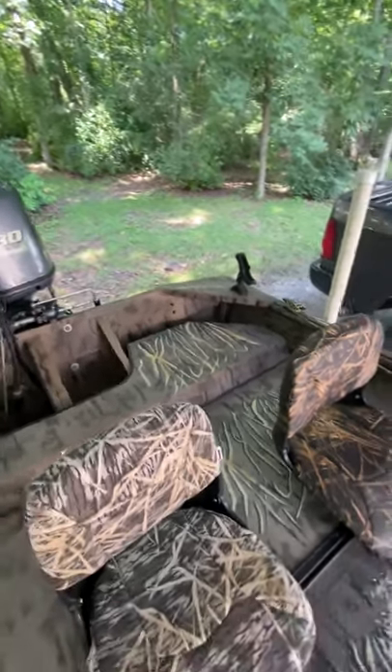So I got with River Rat Pumpworks — I think they're out of Missouri — and got a stainless steel impeller with a slightly different cut. The day I went to test it, it was really rough out with big white caps. The boat does pretty good in chop, but it's an aluminum boat and you'll beat yourself up. I only got up to 29 miles an hour, but it had a lot more to give. I'm hopeful it'll hit probably 35 miles an hour with the new stainless impeller. It sure jumped out of the hole a lot quicker, got up on plane real fast, and the acceleration was significantly better than the stock impeller.